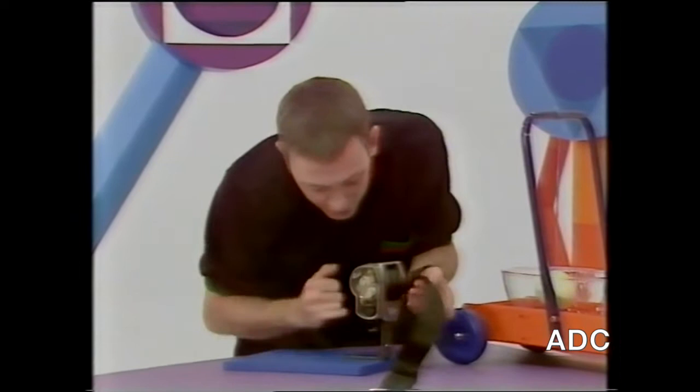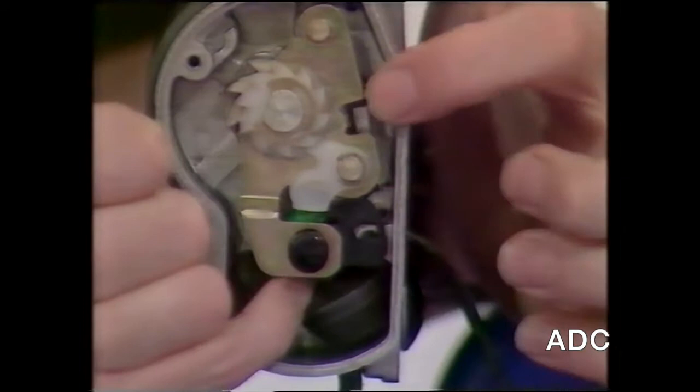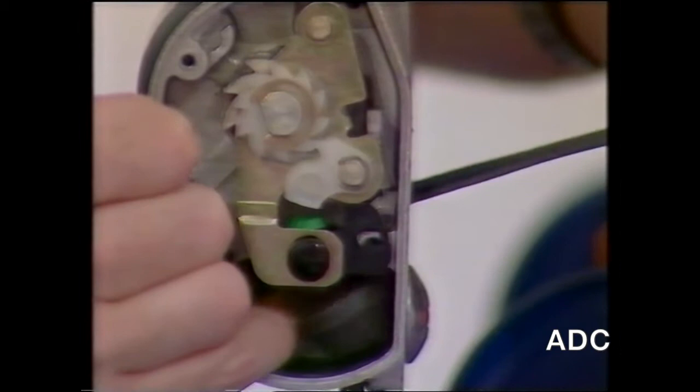Look, there's the pendulum swinging freely, and that's the side of the bowl. Now then, if the car moves smoothly, it swings without touching the side. But watch what happens if the car comes to an abrupt halt: the pendulum swings right to the side, moving that lever there. Do you see that? Now that lever then jams that cog, which stops the seatbelt from moving and holds you safely in the car and stops you from being hurt in a crash.